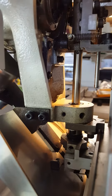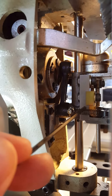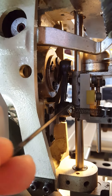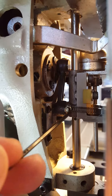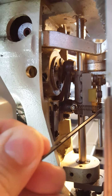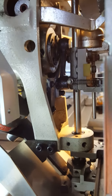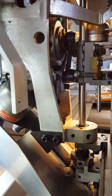If it is not fixed, the other thing that it could be is the spring on the needle bar driver. It's either come off of this post — there's a little hook, it just hooks on this post — or it hooks on your needle bar driver. One of those two things has come loose and needs to be re-engaged and lined up properly.